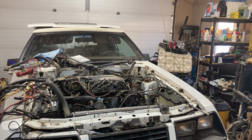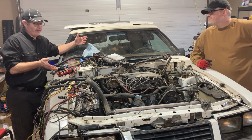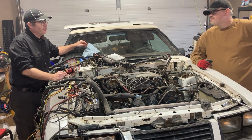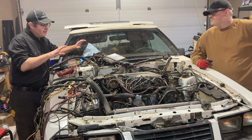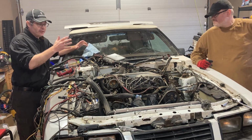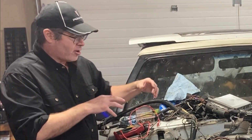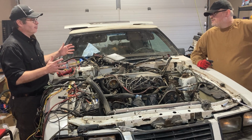I would call that a success, sir. So there you go, man. This is an '84 Mustang, not really meant for this. It was originally a fuel-injected car, but it was a CFI fuel-injected car. So it's a completely different system, and it was pre-OBD, so OBD2. So we got the OBD2, we've got distributorless ignition. Now we just got to get the car wired up to this, which, if you know where everything comes from in the car, it's not a big deal.